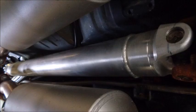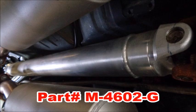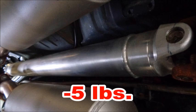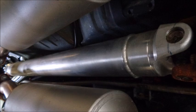Ford Racing makes an aluminum driveshaft for the 99-04 Mustang V6. It weighs about 14 lbs. The stock part weighs 19 lbs. Like the aluminum flywheel, this mod takes rotating mass out of the drivetrain, leading to quicker acceleration and getting more power to the ground.